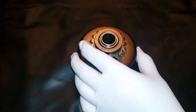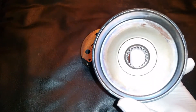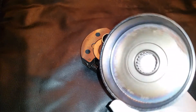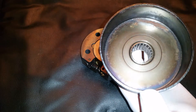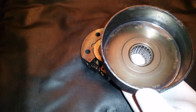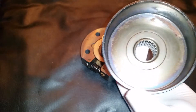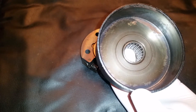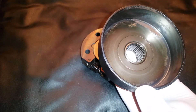It's as simple as lifting the top drum off the hub. Let's take a look inside — it's fairly nice. I did clean this a couple hours ago just to keep my gloves and tools clean. There is a roller bearing, which is a nice feature, and every time you open up this clutch it's a good idea to add a little bit of high temperature wheel bearing grease to the roller bearing, just for good maintenance.